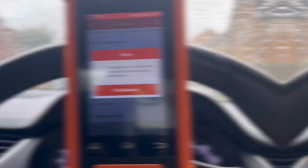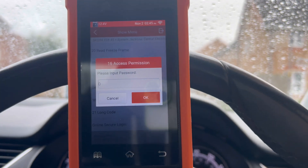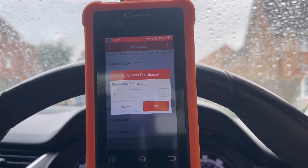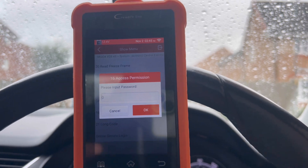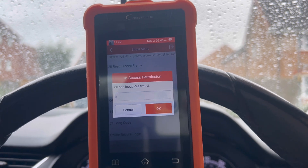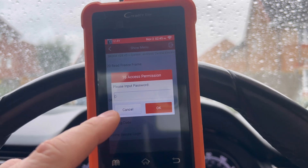You can do online secure logins and it can literally tell you everything. So the online bit — access permission — I've got all the codes you need for all the control modules on this car in particular. It'll go across to the A3, the Audi A3, Volkswagen Golf. I'm going to put the link of all your passwords down below in the description. Now what I want to point out guys — please be very, very careful. If you're coding or messing around with any adaptions, please save it or know what you're doing so you don't accidentally upset something and render your car undriveable. That is your disclaimer guys — this is just an overview of what the tool can do.